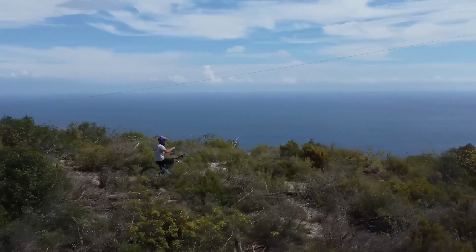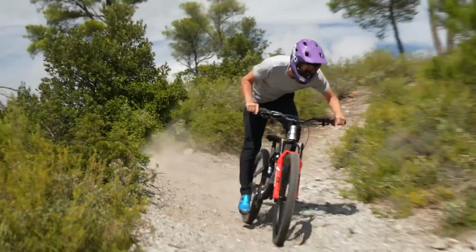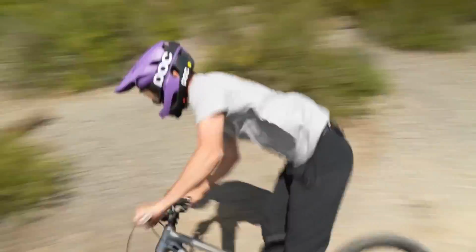Even bikes that you see in the shops that are raw aluminium, they're not technically raw aluminium. They would be anodized or clear coated to protect that surface. So I would say, no, there's no disadvantage to taking the paint off if it's done properly. But I would put a clear coat over the top of it to stop it from corroding. You can get some spray clear coats, even matte satin finishes, and bike specific ones too, if you want it to still look natural and not be glossy.